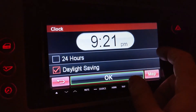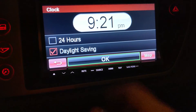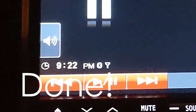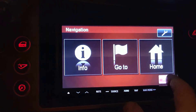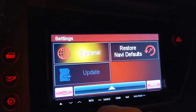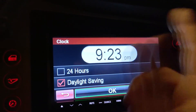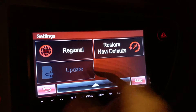Look, you could put this to what I would call military time. That is actually correct - I don't know how suddenly that's correct. I think what happened is I entered the navigation menu, which then pulled my location and the actual time from my location, which is correct. So I just went to Regional - that's where I got it. I went to English US. Clock. I'm over here - it was correct, it's not allowing me to change that. I could go over to 24 hours if I wanted. Anyway, this is how you do it - you're in, you're done. Press audio, takes you back to the audio screen, and the time is correct.